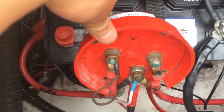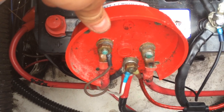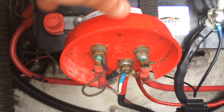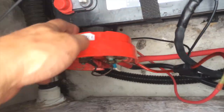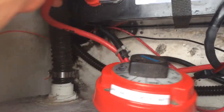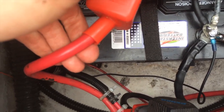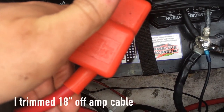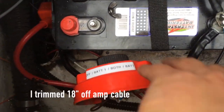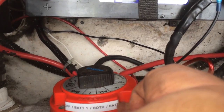Or I can turn it off now, which is a lot better — less parasitic draw. It's still connected by a very large and short battery cable, so it's not like I increased the distance from the amplifier to the battery, because that's what you really don't want to do with these 12-volt amps. It gives me a little more safety and flexibility and it's really easy to do.